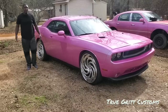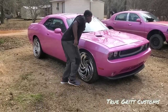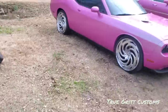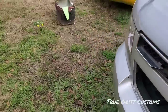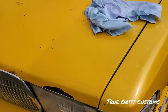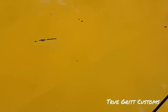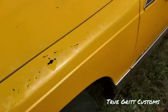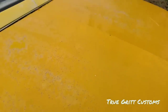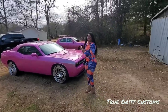Who does that for $1,200? That's what they were doing when I was charging $1,200. Now when I charge $2,500, most cars come in like this — paint peeling. When the paint is peeling you gotta scrape it, take it down to bare metal. That's a hard job, nothing easy about it. If that car comes in like that it would not be a $2,500 job.